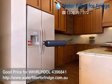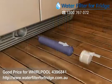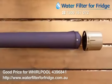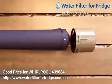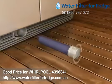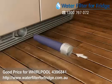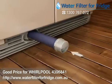Place the filter cartridge cap that was set aside earlier on the new filter by aligning the ridge on the cap with the arrow on the filter. Turn the cap clockwise until it stops and snaps into place. Hold the assembled cap and filter unit by the lip on the cap so that the filter cartridge arrow is facing up.